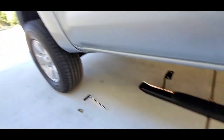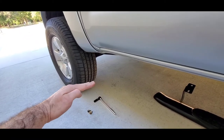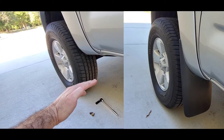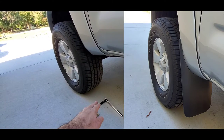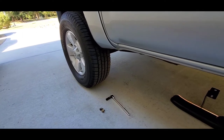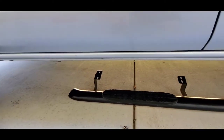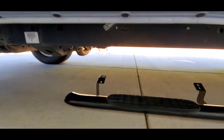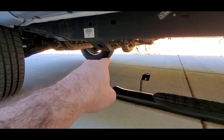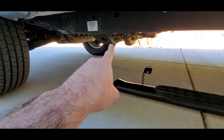I did a three-inch lift in my last video and took the mud flaps off. The mud flap used to come down about that far below the tire, so it only looked like I had about four inches of clearance. Now I've got all that clearance between the fender and the ground, which gives a much better stance. I don't want to completely give away my clearance, so I'll be looking at where these bars mount up relative to the ground.